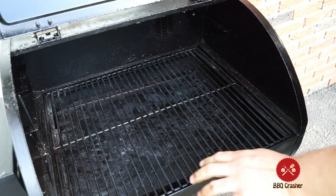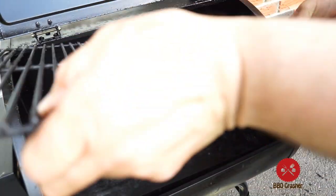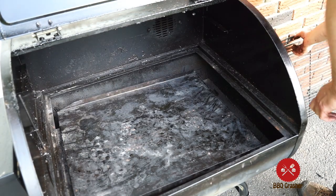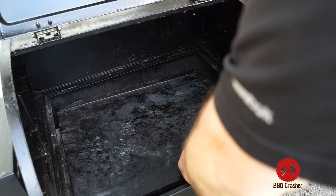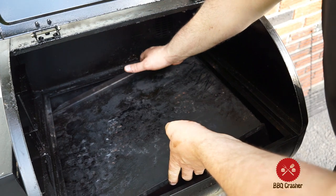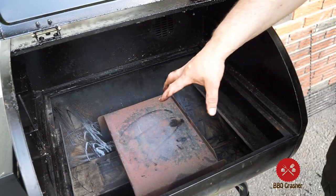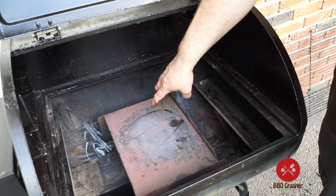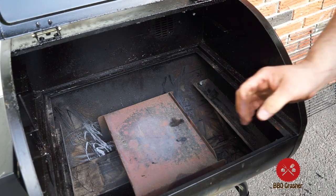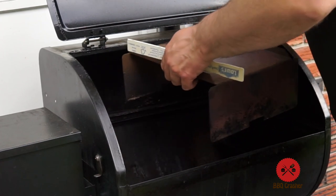Let's go under the hood here. This particular model only comes with one cooking grate. With the grate removed is an oil collection pan or flavor pan. It's on a slight angle going down to the right, allowing the oil to drain through a trough and out to the outside of the unit into the oil collection bucket. Underneath that big pan is another stainless steel piece of metal that protects the open flame of the direct pellet burn chamber. Here's another angle of that being removed.